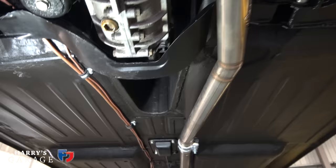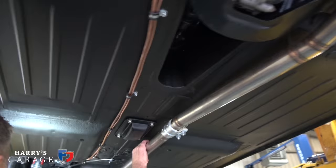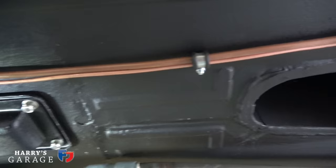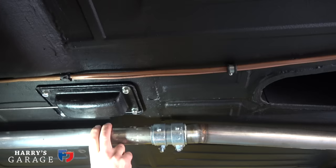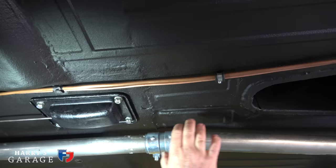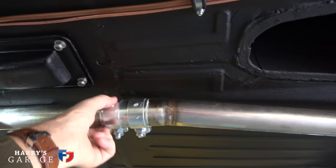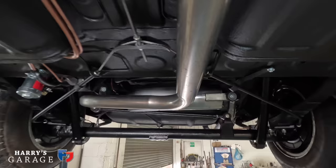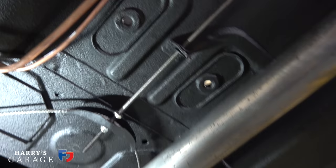Walking down, the fuel lines — the original plastic ones have been replaced with copper ones, with all systems on. This is part of the original system, cleaned up with new hangers. The original exhaust system is actually narrower than what would originally have gone on it — the car has accepted it, but we have the option after it's running to put a bigger system on. The MSF one does actually go over this one, but the back box isn't quite as nice, so we'll run it with this for now and see how it looks.